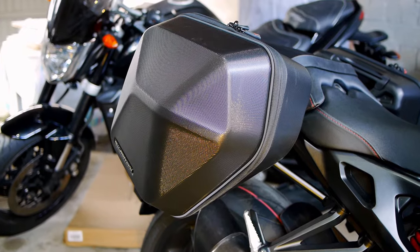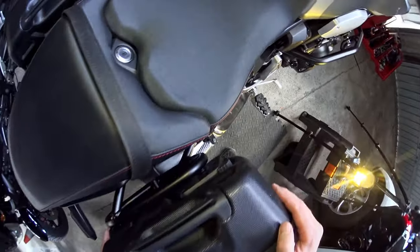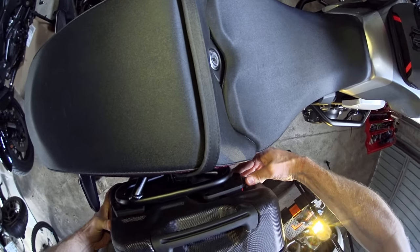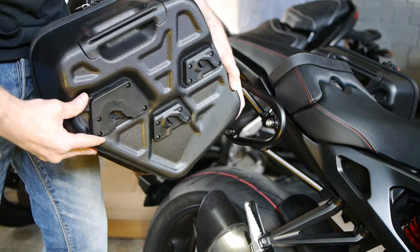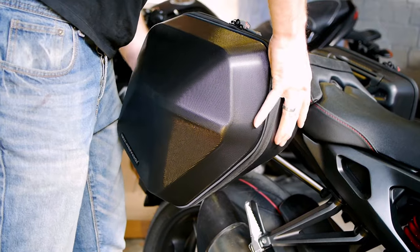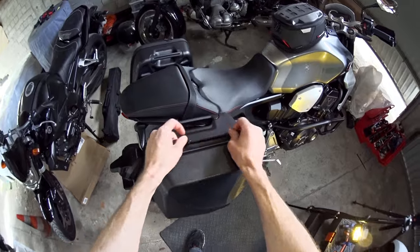This kind of not-quite-shiny, not-quite-matte textured finish is a good look — I think they complement the bike pretty well. Nice, simple, subtle colour — solid black, I like it. Now before I open the bag I'm going to show you how we take it on and off. It's latched onto the little bobbins on the rack, and there's a little lever in here — push that down, lift the bags forwards and up and it comes off. You can see the locking mechanism in there. To put them back on, just line the catches up with the bobbins, push down and backwards — click — and we're on.